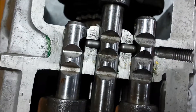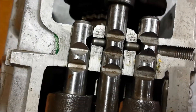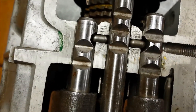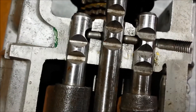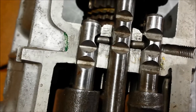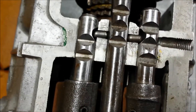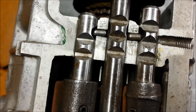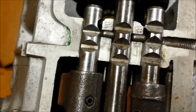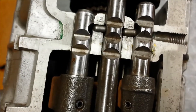When we move one of the shafts into gear, you can now see that the interlocks move outwards and they lock the other two shafts in position, so they can't actually move into mesh of another gear. The third and fourth shaft comes back into the neutral position, and now we can move one of the other shafts.